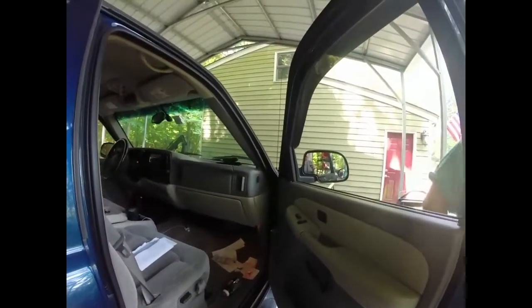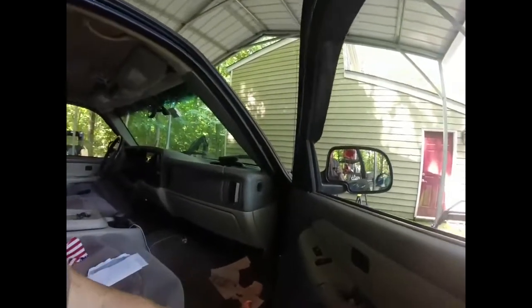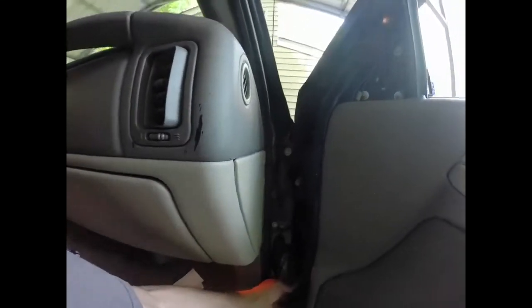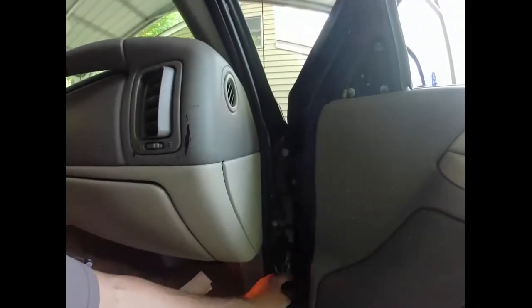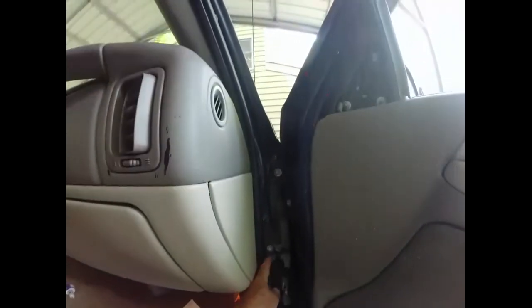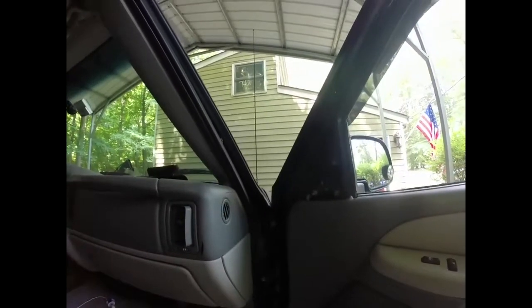Over here, first things first, we've got to figure a way to pull the door panel off, and then we've got to take the mirror off. The hardest part about the whole thing is the electrical — we've got to pull all the wires through. Luckily, this just clips in. We'll pull this out and pull all the wiring out. There's only three bolts for the door: one down there, one here, and one here. They're all 10 millimeters. Once you get those out, just lift the whole door up and take it away.